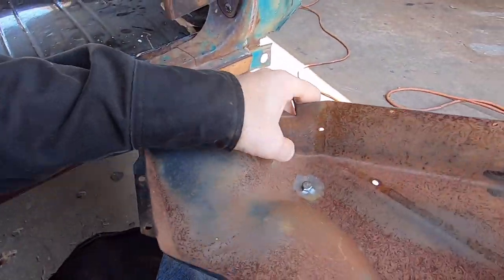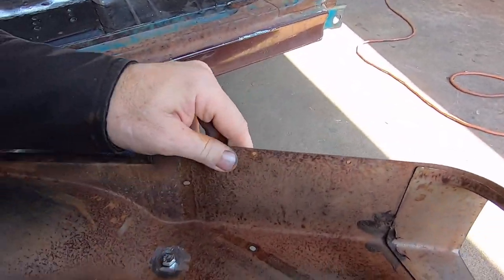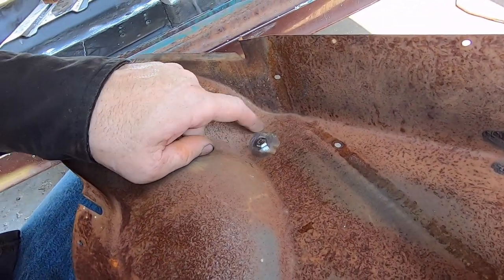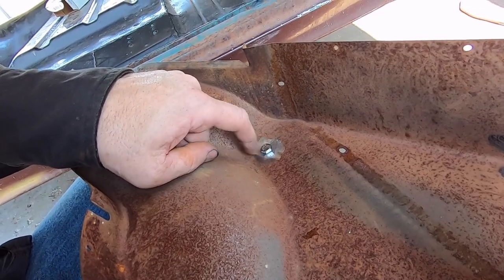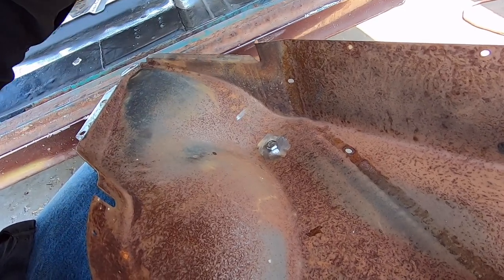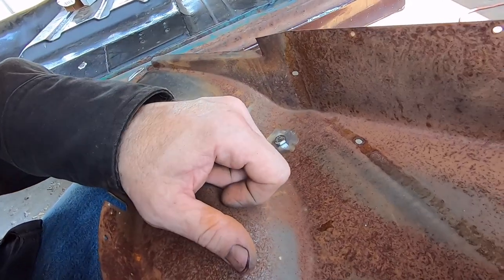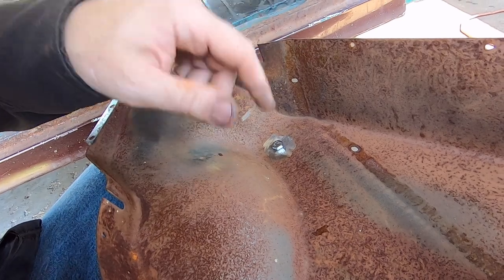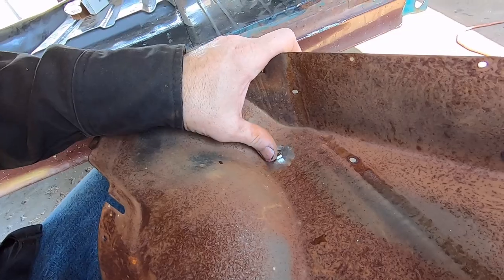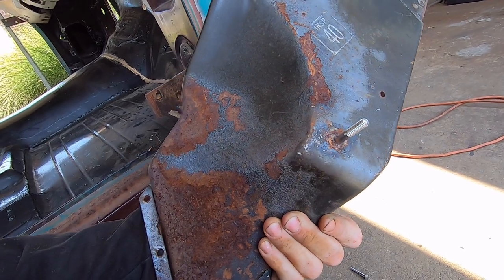This one goes - I'll weld that bolt in there. The problem is when you go to put your heater core in, the heater core is pretty wide. After you weld this in, you need to grind the bolt head about halfway down because the original stud head was a bit thinner than this bolt head. If you put your heater core on top of that it could bend the fins, and with vibration while driving it could cause a leak.